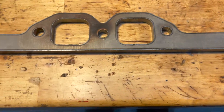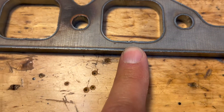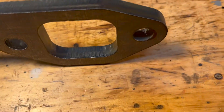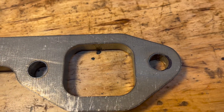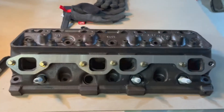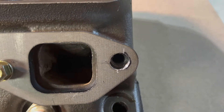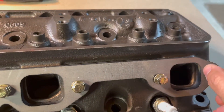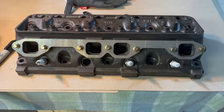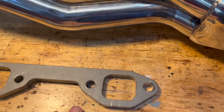I'm going to assume the way this was cut at Speedway or whichever manufacturer - you can tell where the lines are and where everything's cut. These aren't CNC of course, but it's just a little bit off. I went ahead and took a marker to give me an idea of how far I need to go, then I'll test fit. The flange is mounted and all bolts started and loose except for the last one - you can see we're going to be good. Measure twice, cut once. Those burrs make quick work of making that hole a little bit wider and the fit is perfect.